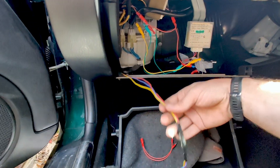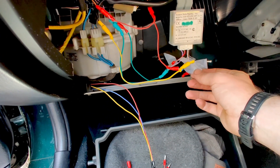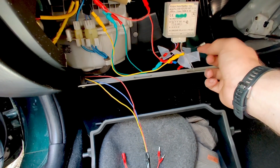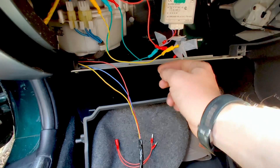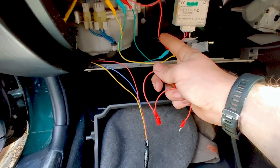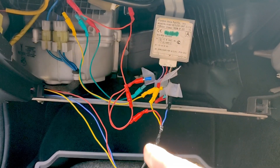So here we are back at the front of the car. Here are my three wires that we ran through. I've just crimped little sockets on the end. Here's the unit and I left myself helpful little marked labels for what all these different things are. So here's the ground that I didn't need before, but I'm just going to pick up off of that for our purposes. This one is the boot signal, and then I've made myself a little Y split connector to splice into the constant 12. Let me just plug that in now. Right, all connected up. I'll tidy this up if we get a successful test. So let's go back to the boot.